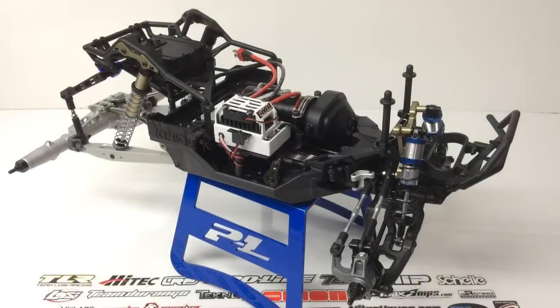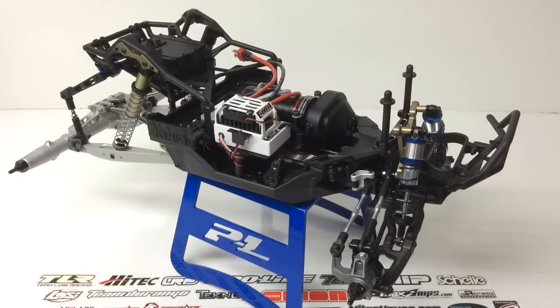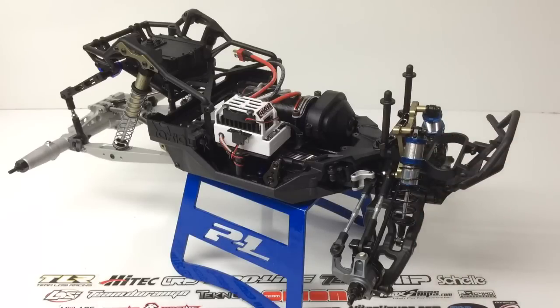I'm back now, and I went ahead and got all of the Tekin electronics installed in my Axial Yeti. Everything went very smoothly, and I just want to go over a couple of things that I came across that may help you with your install. The first thing is this plate right here. The plate that comes stock on your RTR Yeti is specifically made for the Castle-branded ESC — it grasps onto the ESC instead of mounting it. If you look inside your big parts bag that came with your Axial Yeti, you'll notice there's a flat plate for the ESC mount. Simply unscrewing three screws — one on each side, one in the back — you're able to remove the stock one and put on the flat plate so you can mount an RX-8 Gen 2 sized ESC.